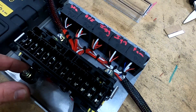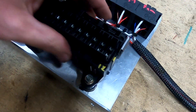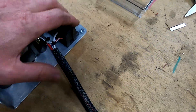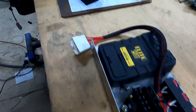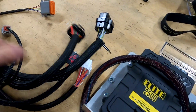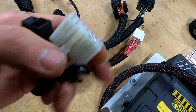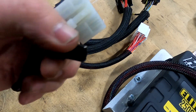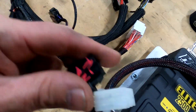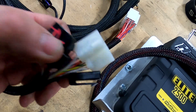On the same plate where the factory ECU and relays were mounted, we've remounted our own relay blocks and fuse box. This has got everything we need — I'll do up these nuts nice and tight. We've mounted them on little insulators just to keep it off the board so we can get the wires underneath. My next step is to test those and connect them into the vehicle. That 12-pin plug is going to be the dash plug. I put a spare earth in but it was number 13 — unlucky — so it wouldn't fit. The other plug is for the fuel pump relays, which are now in the boot, so instead of running power all the way forward and back, we've mounted the pump relays out there.